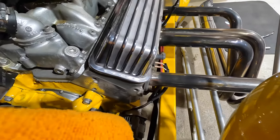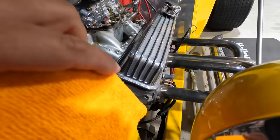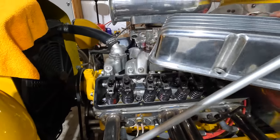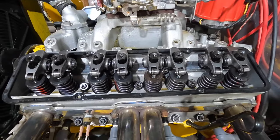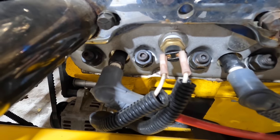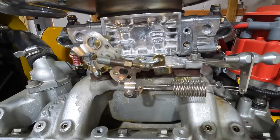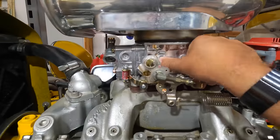I love this air cleaner — it's got a nice two-inch spacer. I don't see any choke on it. It's got an HEI distributor over here and the vacuum advance is disconnected, which is a little weird. We have electric fans. The best part — those heads say ATK High Performance Engines, SBC small block Chevy, part number 64210. You've got these massive headers coming out and just running straight out the side — absolutely beautiful. The carburetor says Holley HP 650, number 0682-something. And it's got ARP head studs — what a beautiful machine.